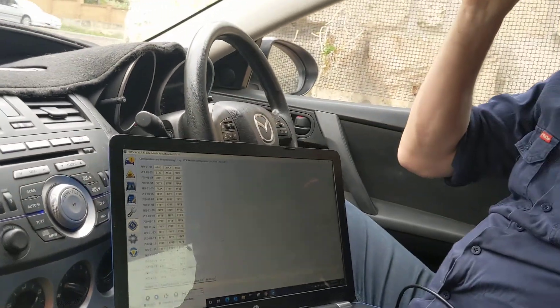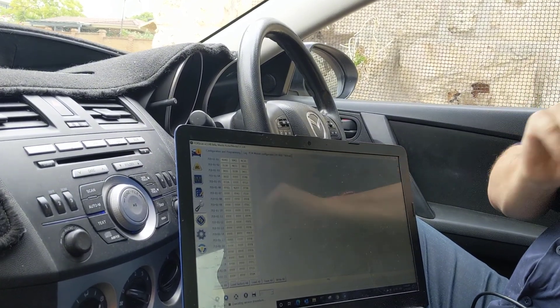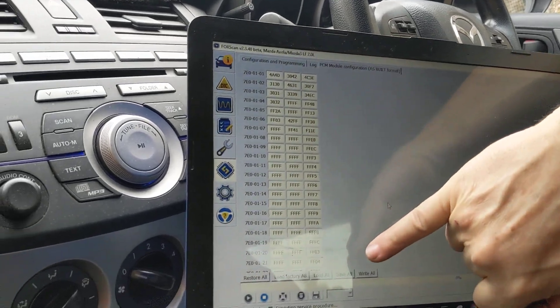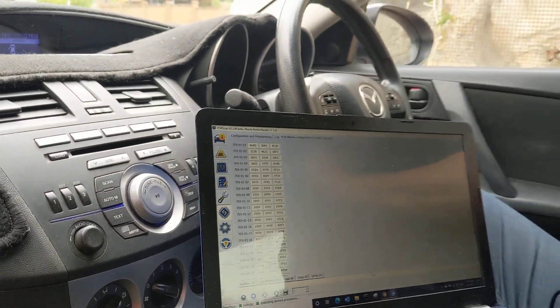If you've ever gone into the BIOS of your computer and set something wrong, you can turn that computer into a brick. This is the BIOS of your car. If you put the wrong thing in here there is a chance you're going to brick your car. So the first thing you want to do is note all of the values — down the bottom you'll see a 'Save All' option. I suggest you do Save All so that if you do mess something up, you can back it out.